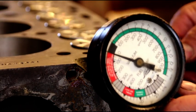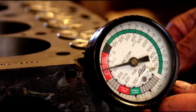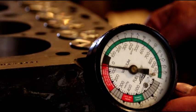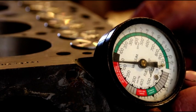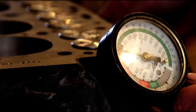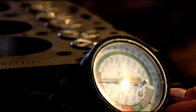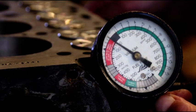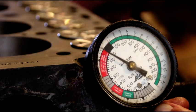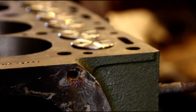We're doing a vacuum test. Exhaust one — not much there. Intake one and two — we're pulling two inches. A little something on exhaust two, that's good. Exhaust three — nothing. Intake three and four — pulling a couple. Exhaust four — nothing. Exhaust two is the only one that sealed. You can imagine what this engine was going to run like.